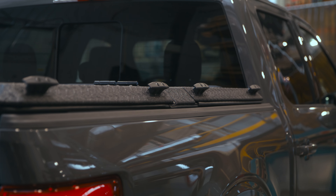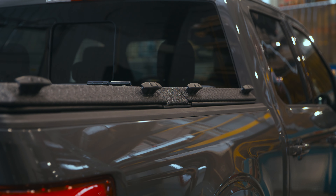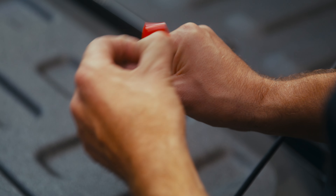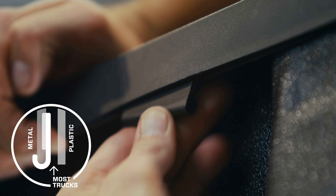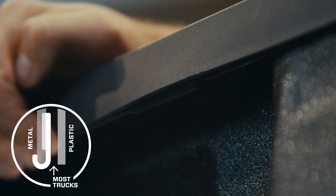To make opening and closing your panels easier, apply downward pressure on the panel while turning the lock handle. Now it's time to attach the bed rail edge trim. These pieces will help your lock rods draw the panels down and compress the weather strip. Peel the red adhesive backing from the edge trim pieces and affix them to the metal bed rail at the four points where the lock rods pass underneath. The curl of the J should wrap around the bottom edge of the bed rail.